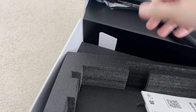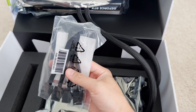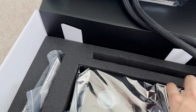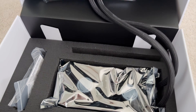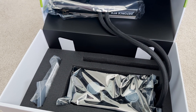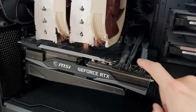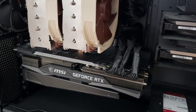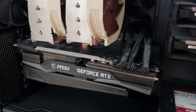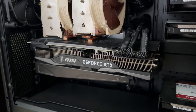We'll have to mount the radiator, which is underneath all of this, inside our case. Fortunately we have a big case — the be quiet Dark Base Pro 900. There's a power dongle here and then the radiator. Let's try to install this. I'll also give you a comparison of how these two cards stack up with the 3090 side by side. My 3090 is currently mounted inside the case. I'm going to need an extra power connector because this requires four dedicated power connectors. I should be able to mount the radiator on the side or top-mount it.